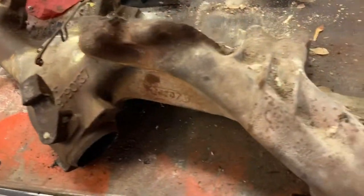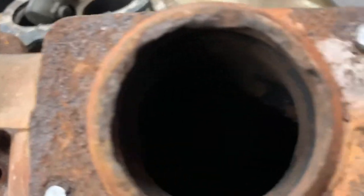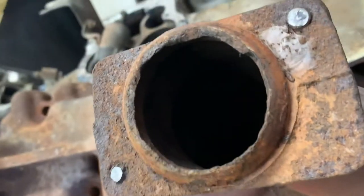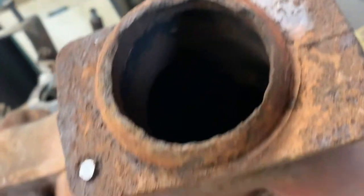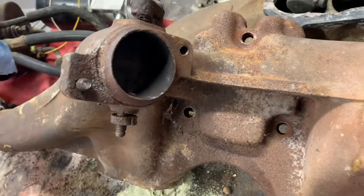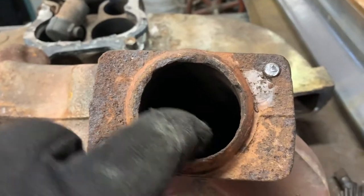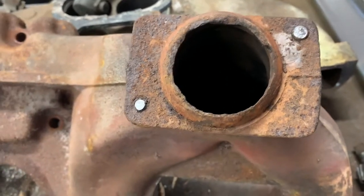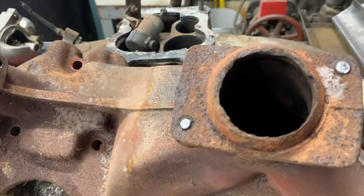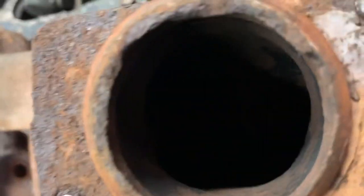If you flip it over, you can see that this outlet's kind of ragged looking. I can't say that's corrosion — it might have always been like that. I'm going to open it up anyway so they match. This one's slightly larger; this one measures just shy of two inches, probably two inches with no carbon and rust on it. This one's more like one and three-quarter at the opening. So I'll grind that open too so they're both equal, and I'll try to take out any restrictions inside if I can see anything.